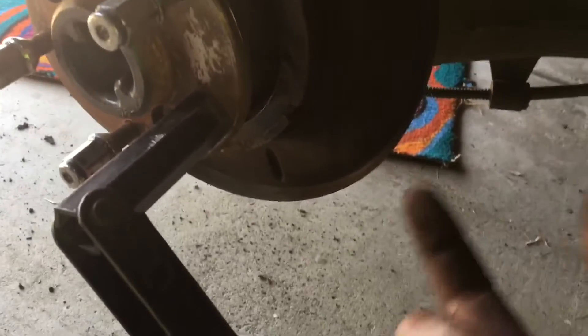Then you end up using your wheel wrench. For Commodores it's 19mm. Just slowly work it, and check every couple of turns that it's coming in. I've still got a little bit to go - just check every couple of turns that it's coming in nicely. Probably one or two more turns on this one, and as you can see, that's basically in.